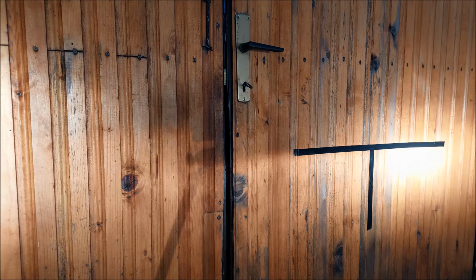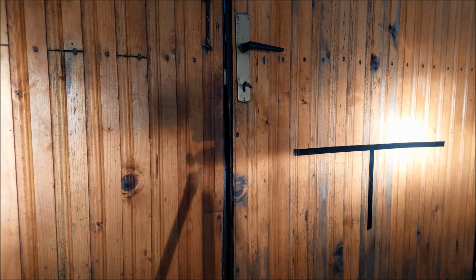I'm actually not gonna mess even with the high beams too much. I'm gonna put them back into their original position. Then I'm gonna later on find a nice dark road. I'm gonna take my small ratchet and 8mm socket, and I'm gonna adjust the light beam so it has the best possible visibility. Also, I was only able to turn this little screw 3 times. So just to be clear, here the clockwise motion is gonna move the high beams down, and the counterclockwise motion is gonna move them up.